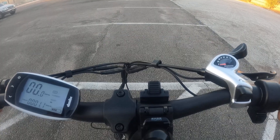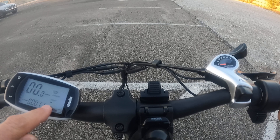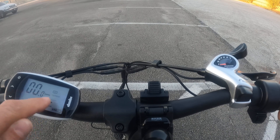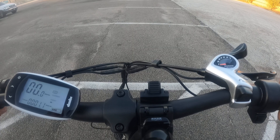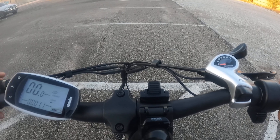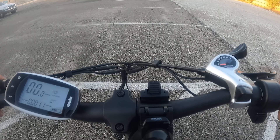In this video we're going to go over the progressive torque control. On your LCD, on the left you have your assist level and current level — they are two different things. Your assist level is 1 through 5; your current will give you a rating between 0 and 10 amps. The bike does much more than 10 amps, but that gives you a better window where you can improve your range by minimizing that 0 to 10. You will go above that when climbing or accelerating, but for most riding you'll be in that 0 to 10 range. If you can drop the current down one or two bars you'll definitely significantly increase your range.